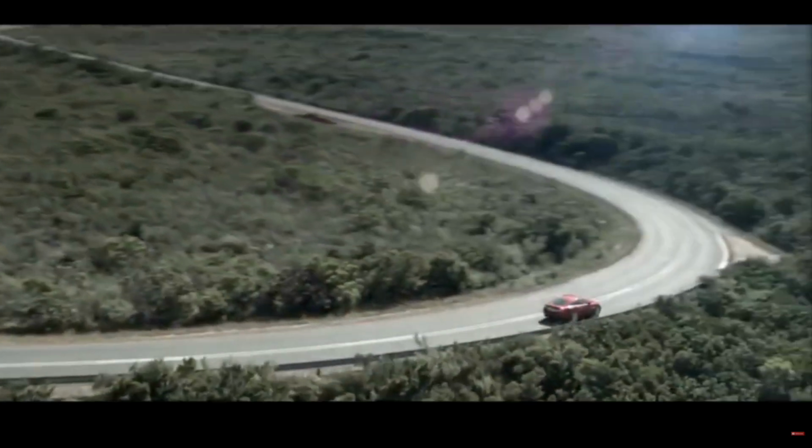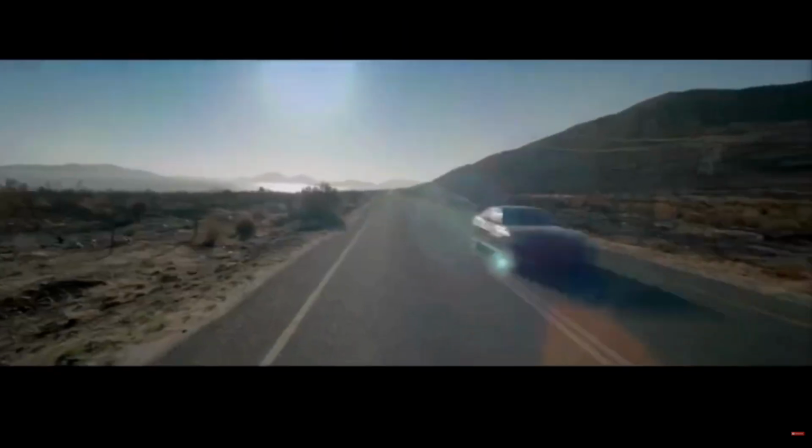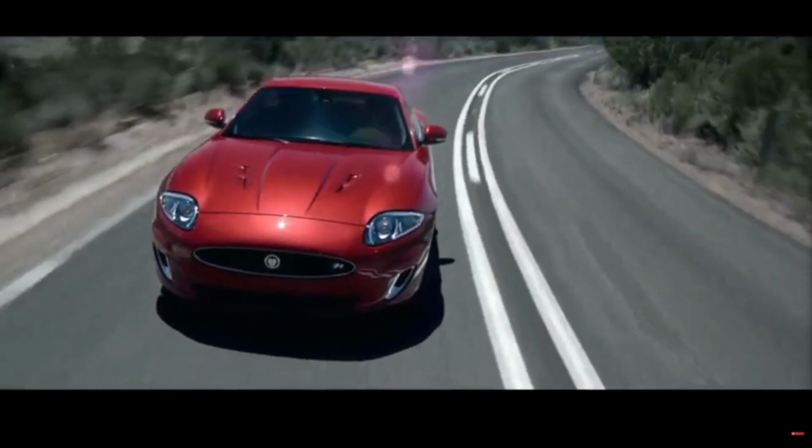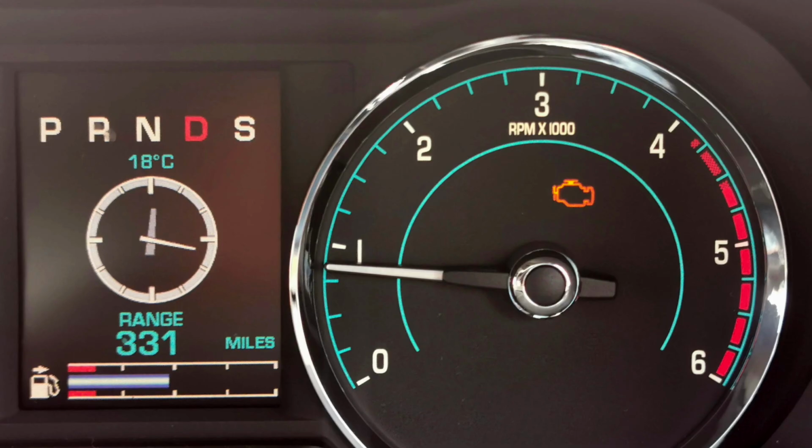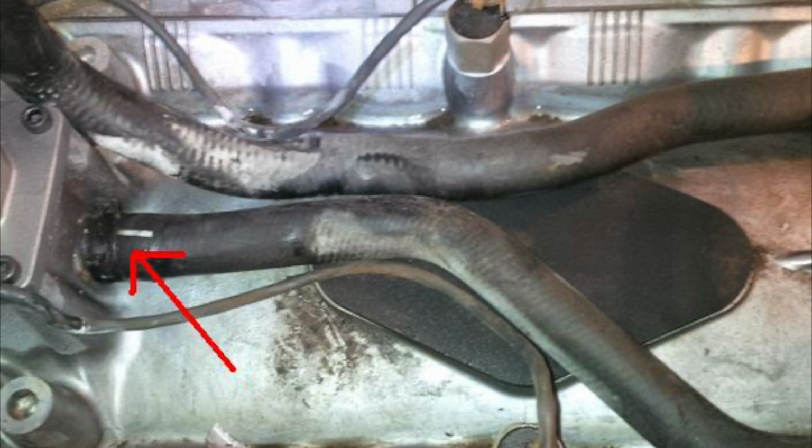But Jaguar should have cured those problems on the earlier cars under warranty. The 4.2 litre car can have perished vacuum hoses that split with a warning light, and when you feel them, they'll be brittle. Replacement tubing is available. Also check that there are very few gases coming from the exhaust. The 4.2 XKR could puff a little oil smoke on cold start.